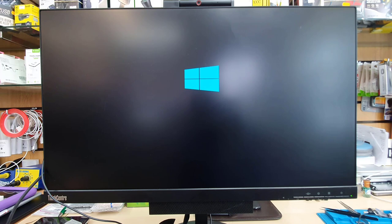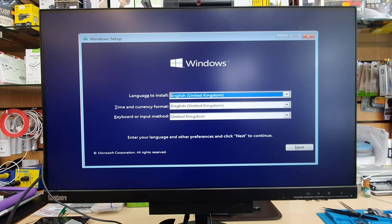And then from the boot priority section, you need to keep the USB in number one by pressing the plus and minus buttons on the keyboard to choose. Okay, here it is, pretty simple now. I believe everybody knows how to do that, but still I'm going to keep running this video until the end to see if the boot is successful or not. So stay with me and enjoy the rest of the video.